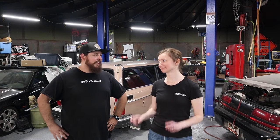If you slam on the brakes pretty good, it locks up the passenger rear tire. So I'm assuming the driver's side rear caliper is bad. Hopefully it's the caliper and not the line. We'll take it apart and replace everything. Let's do it.